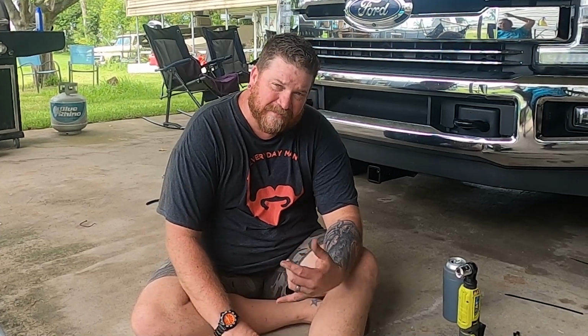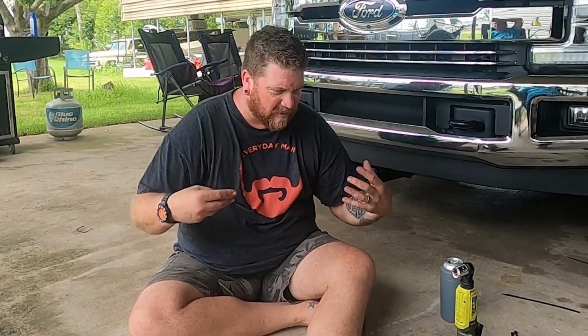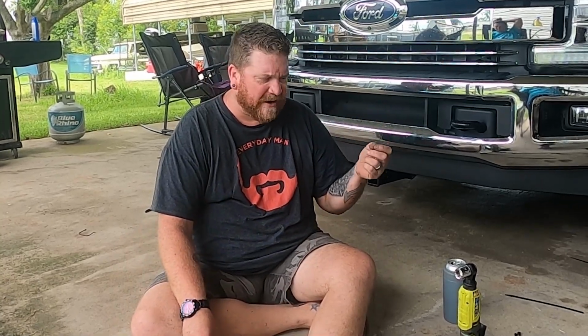The holes didn't line up. But you don't realize that till after you got everything up in place. So what I should have done is, well, it would have been really hard either way. I was gonna say what I should have done was put it in place first and see if all the bolt holes lined up. But you gotta use the fish wires. So once you get your wires fished in, once you get it up, there's really no going back. Especially after you pull in a couple of the bolts and pull the fish wires off, because after that you ruin the fish wires, and that's where I'm at right now.